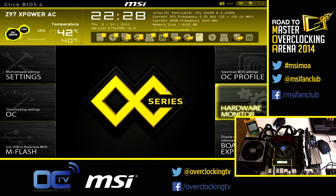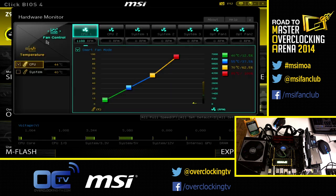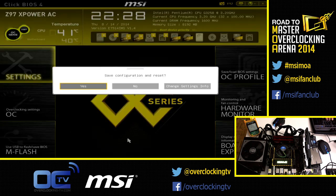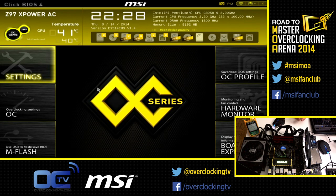Let's go to the hardware monitor now. As we are overclocking, it could be interesting to change the fan speed. Right now we are using the default CPU cooler, but maybe I want to have more than that. So let's set everything at full speed — all the fans, I want them to go as fast as they can. I'll press F10 to save the configuration, say yes, and that will reboot at 4 GHz. Let's see if this is working.